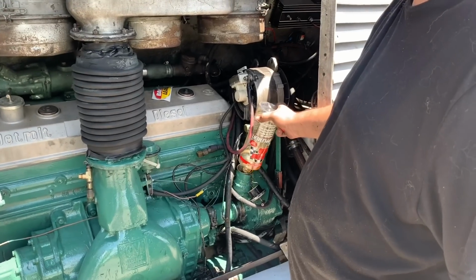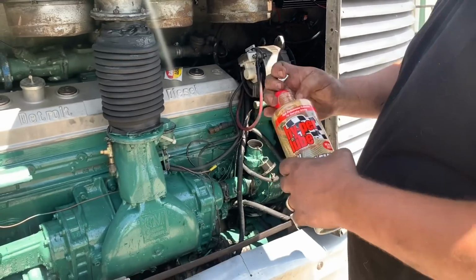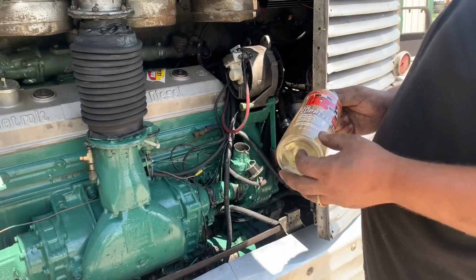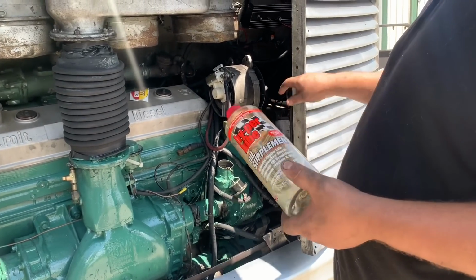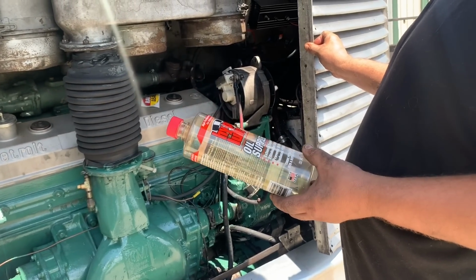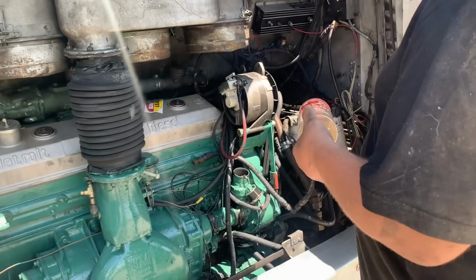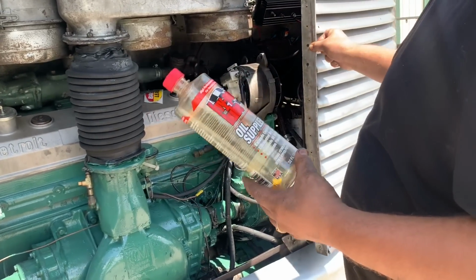gearboxes, anything to get that added protection where the Hy-per Lube will stay clung to those internal parts. Even with an older style gearbox, if you put that in there, you take off down the road, it's basically gear on gear, no oil until it gets that stuff slung up there. But once you put Hy-per Lube in there, it stays clung to all those gears, and you don't have to worry about that on a manual transmission in an older truck. Yeah, which I have a manual 4-speed Spicer on here. Probably wouldn't hurt to think about adding that to there as well.